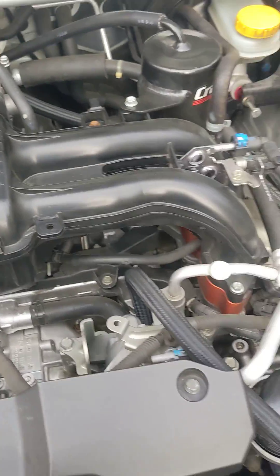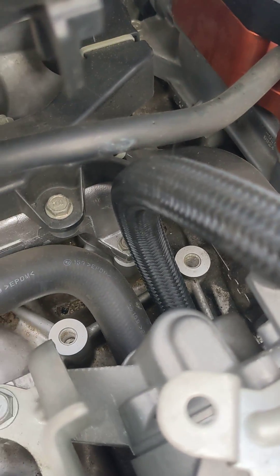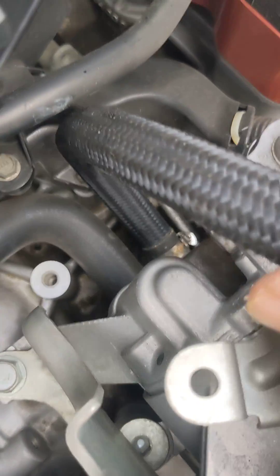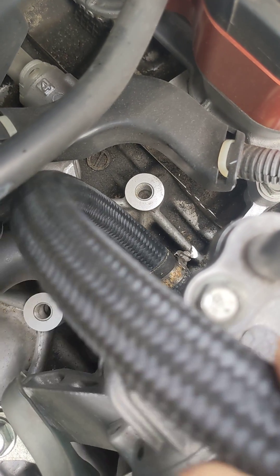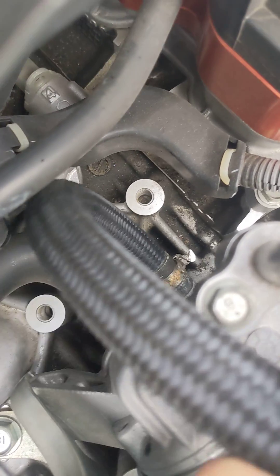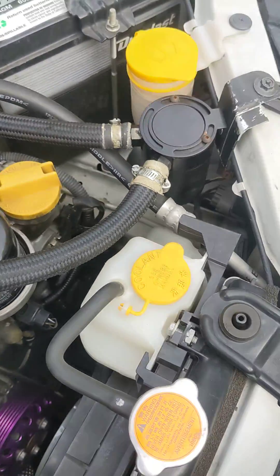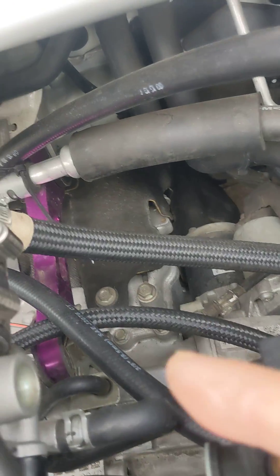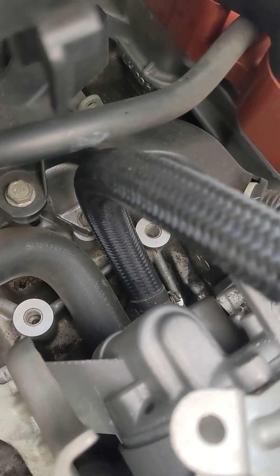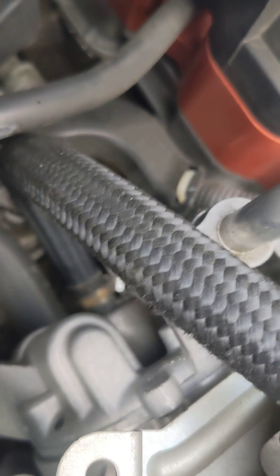So it's a kind of recycling of that air, because it has a lot of oil — a lot of oil that gets sputtered out. And you can see, look, now that the seal has been broken, you can see how that hose clamp is loose. There's some oil there. Typically, that's what my catch can is for, and I've sealed these up pretty well. But here is now the weakest link and it's blown out.